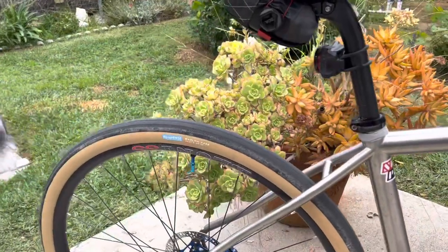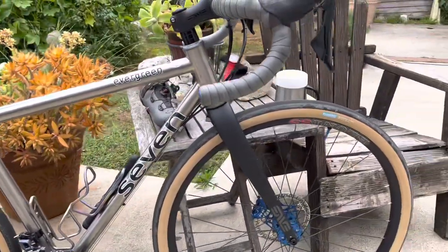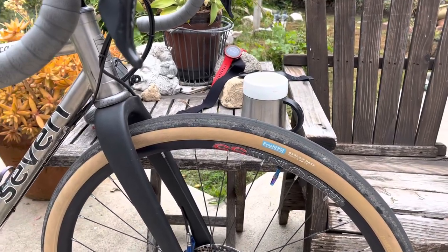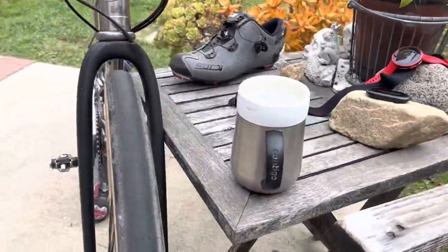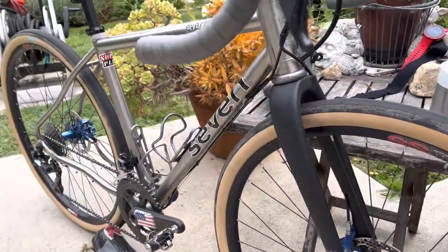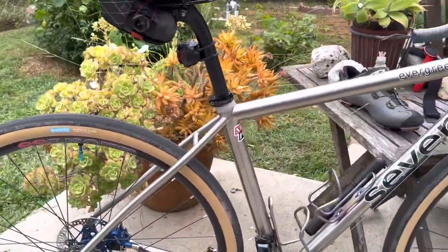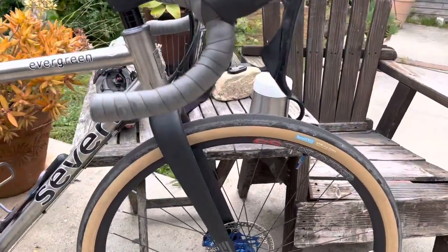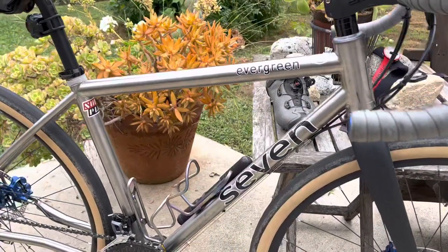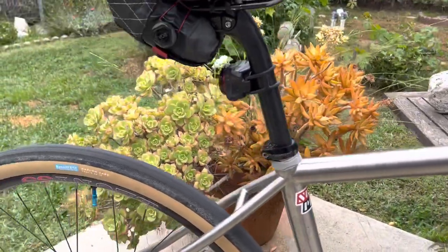The rear set up pretty good — it really depends on your rims. These rims set up tubeless really easy. These are the Velocity Blunt SS, which are actually a mountain bike XC rim from years ago, made in America. They're an XC rim that I'm using as a gravel rim because of the 26.6mm internal width. I really think if you're going to use gravel and run bigger tires, you need to go wider. I'll show you another tire in the next video where I'll be going bigger.